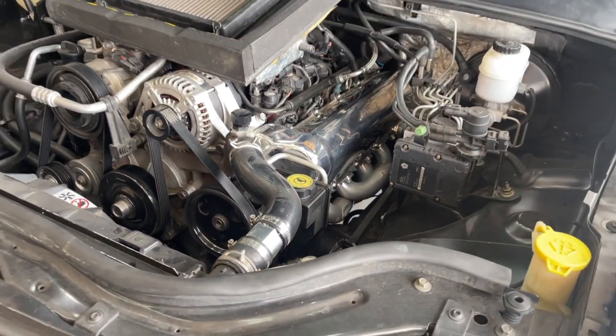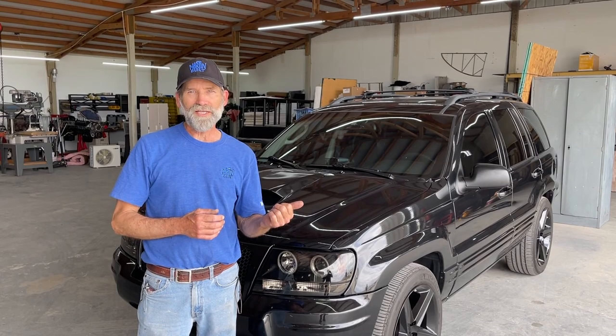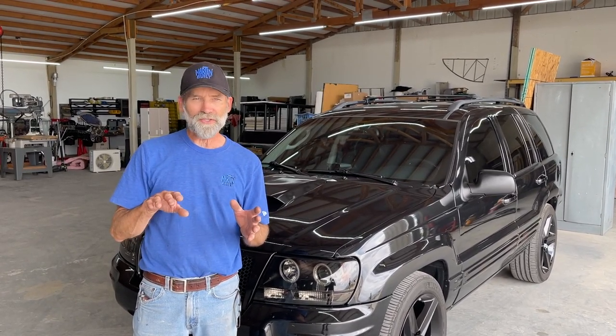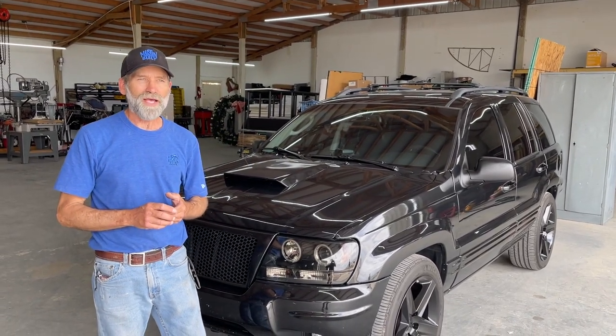So what are some of the things that you've done to it? I started with the HO cams, the solid lash adjusters, and then I went to the '08 camshafts. I've also got the '08 intake manifold, and it has a 75 millimeter throttle body. That is from the 454 Chevrolet engine. What did they call it? The Vortec engine, I believe. Vortec, it was. Yeah, I took one throttle body off of that, made an adapter.